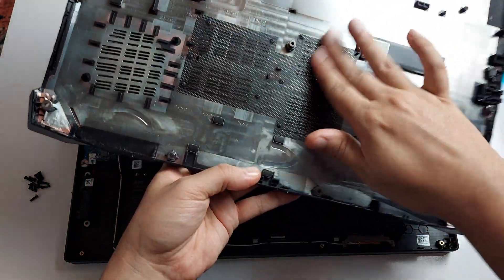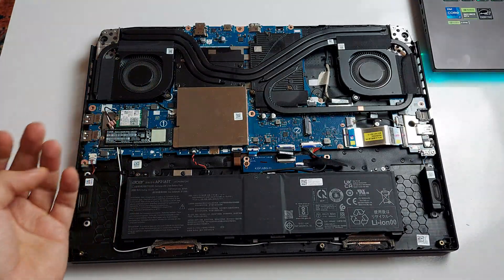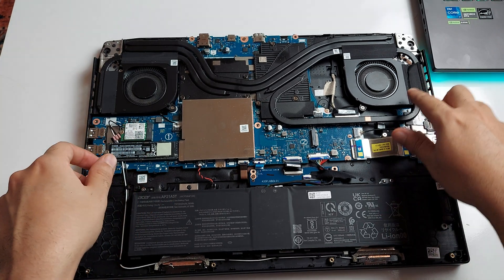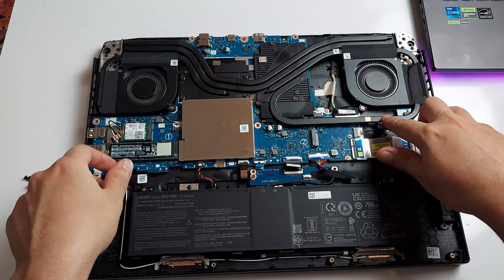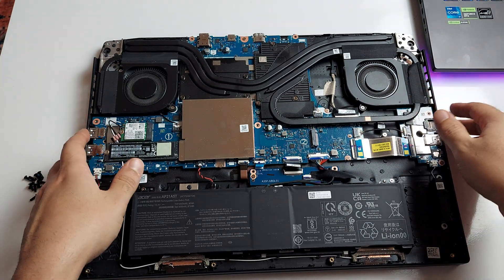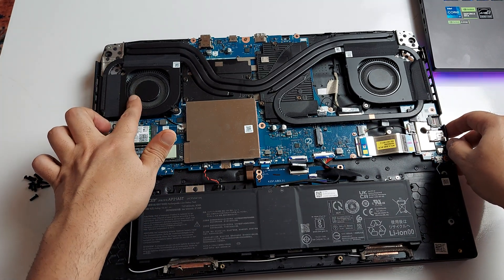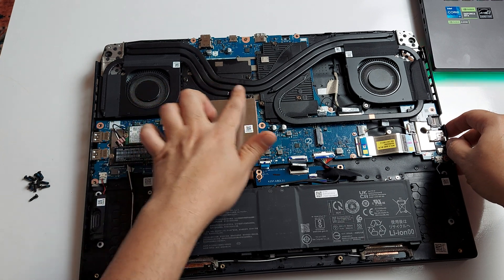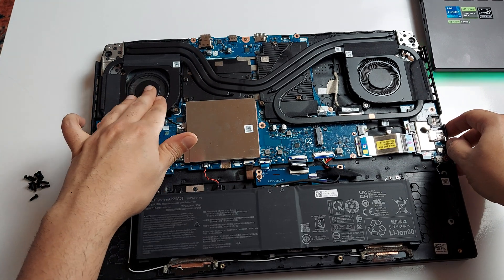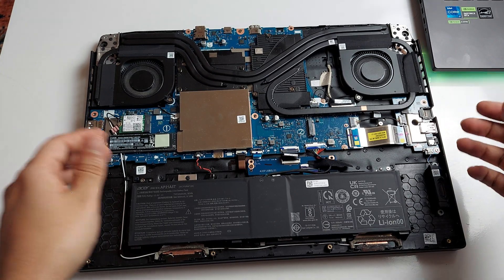If you need to do some cleaning, you could clean the mesh in there. This is already a very new and clean unit. Here you have four heat pipes for the graphics card with a small fan — I wish they put a bigger fan, but they made some compromises. And here we have another small fan and three heat pipes, two of which are shared between the CPU and GPU, and one goes the other way. It's a quite cool unit since it's 17 inches.